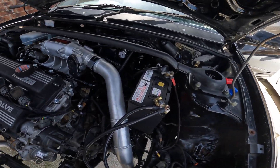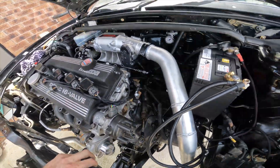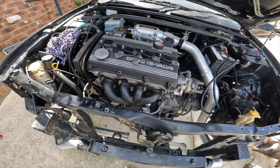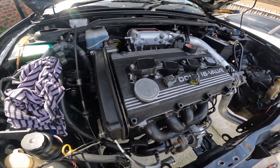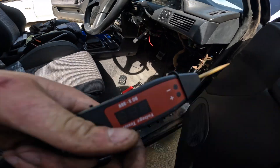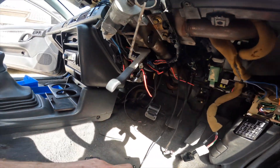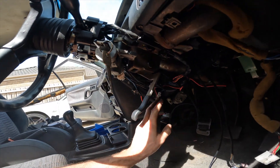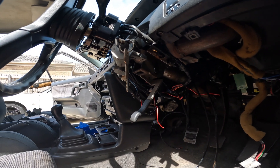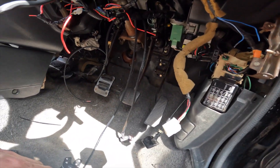We've got a dodgy battery setup in there using one old terminal, just because I haven't redone the alternator loom. Only connected up to the starter, the fuse box, and just a couple of earths — one to the chassis, one to the engine. One of the coil packs done just to work out the length. Inside, I've got the test light in front of me — it's bad in here. Connectors that never belong on a car, spliced into all sorts of things. I'm going to power up the Haltech now and tidy up a couple of things.